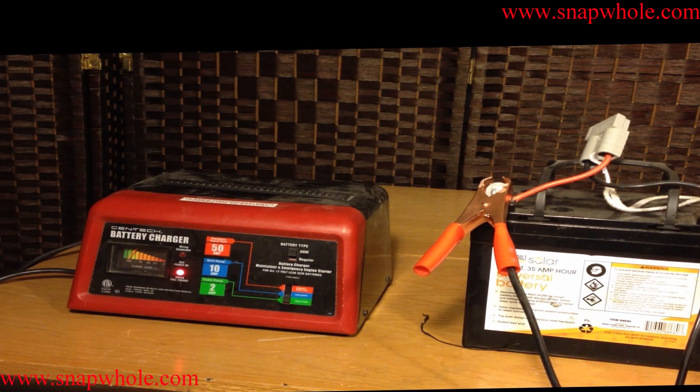There's a process called deep cycle. Deep cycle is the process of using a battery until it's almost completely dead. Your car battery never does that unless you have a problem. A scooter battery and a UPS battery, on the other hand, will run a battery completely dead. The AGM — absorbed glass mat — seems to handle those deep cycles a lot better, though it still damages the battery. You should never completely discharge a battery; it will shorten its life dramatically.